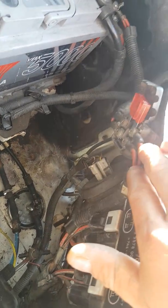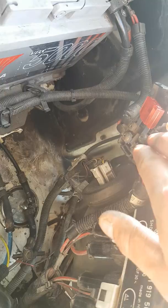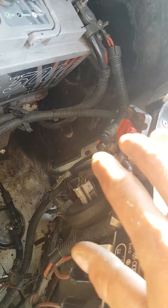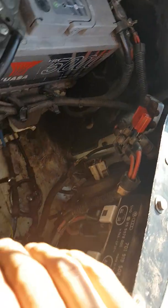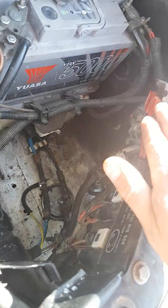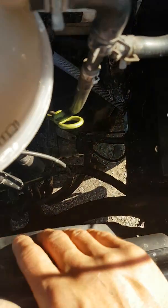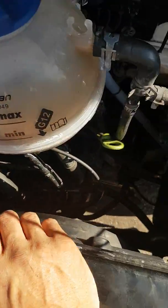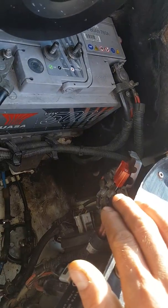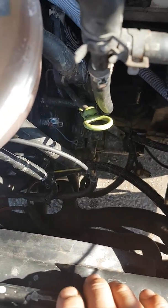There's a link I'll be putting on to an eBay site where someone who really knows what he's talking about recommends a 30 amp fuse. The 30 amp fuse is still plenty to run the fans, but in the chance of an overload it will short the fuse rather than burning the fan. The 30 amp fuse is much more likely to blow than the fan, and it's still adequate for running — so you can downgrade to a 30 amp for the safer option and it will still work.